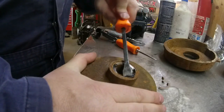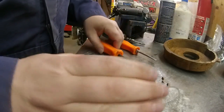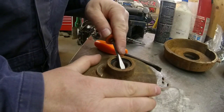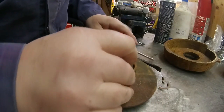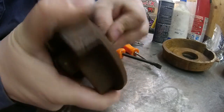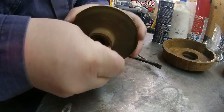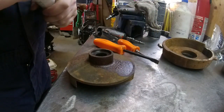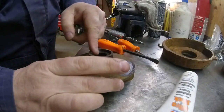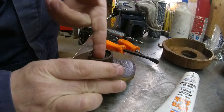Let's get that rubber out of there too. There's a little bit of corrosion, so taking some sandpaper and just kind of clean it around the edges. Then just going to throw a little bit of synthetic grease around there to help make the seal go in a little easier.